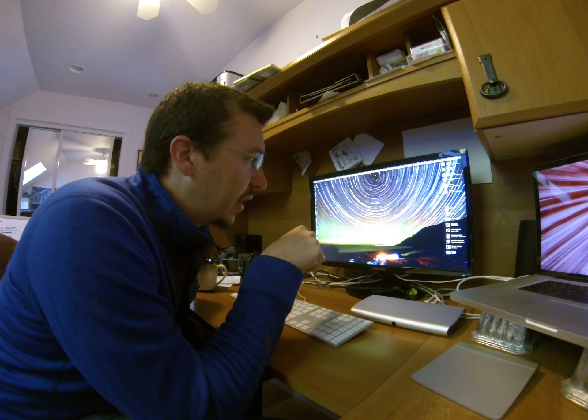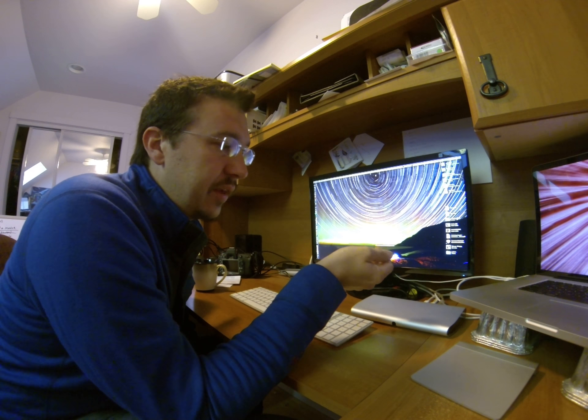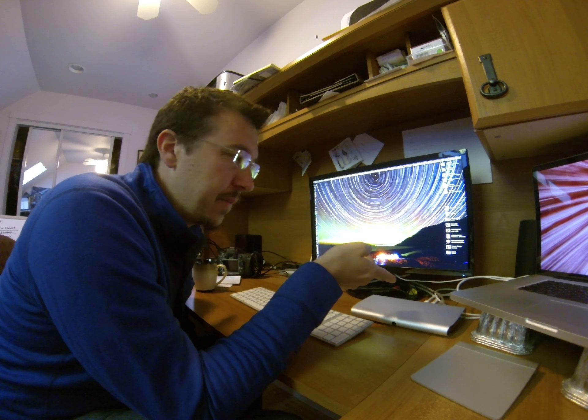Also, for the first time this morning when I woke my computer up, it was on one monitor only, and turning this monitor off and waking it from sleep didn't switch it back to two monitors. Unplugging the Thunderbolt cable from the monitor also didn't switch it back to two monitors. The only way I could get it back to two monitors was to unplug the whole Thunderbolt dock and plug it back in, which is really irritating because I have a bunch of hard drives connected and I don't want that to happen. Again, it might be a function of this monitor.